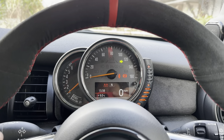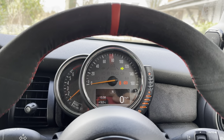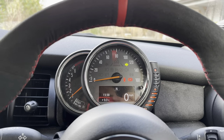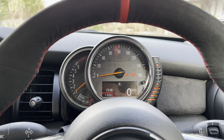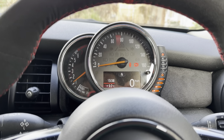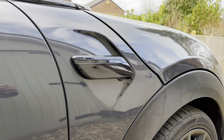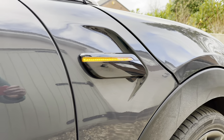We're in the car now. If I turn on the right indicator, as you can see we don't get any of that hyper flashing that you'd normally get when transferring from halogen or filament-based bulbs to LED. These are plug and play — you don't need BimmerCode. Literally take the old ones off, put the new ones on, and they fit perfectly. Same with the hazards — no hyper flashing, which is really good.